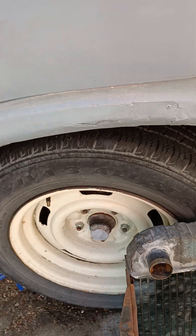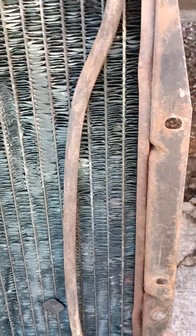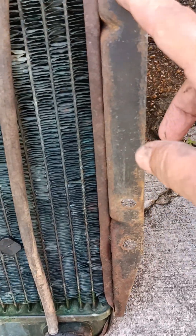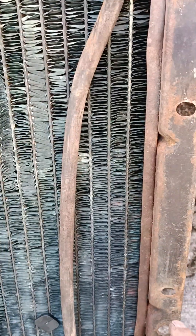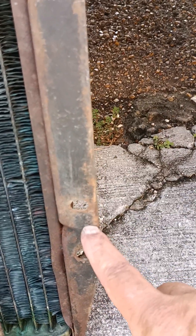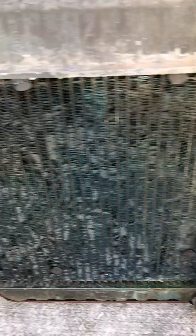Here's the original radiator. Here's what I'm talking about — the flange here. What you do is you measure from this hole on the bottom to this hole, and that's the distance they have to be apart. If I had it to do over, I would probably move up about an inch, and then move this hole an inch up too — the same distance. That way you'd have better clearance on the hose. But that's just after the fact. Mine did fit, no problem.